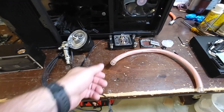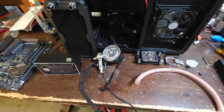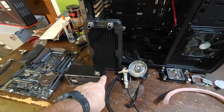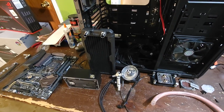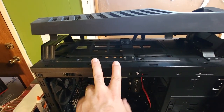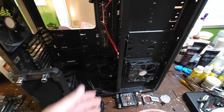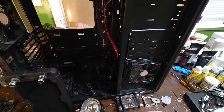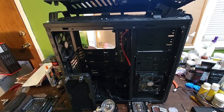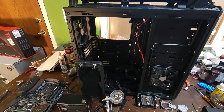The hoses are all caked up too, so I'd have to replace the whole system and start over from scratch. And I need a 360mm radiator — three fans instead of two — to cool a Ryzen 9. The case only handles a 240mm up top and doesn't handle a 360mm anywhere, because there's space for fans and drives in the way. So I didn't have a case compatible with a larger water cooling system. I wanted to water cool it, but should I just use the air cooling fan that came with the CPU? I didn't want to.